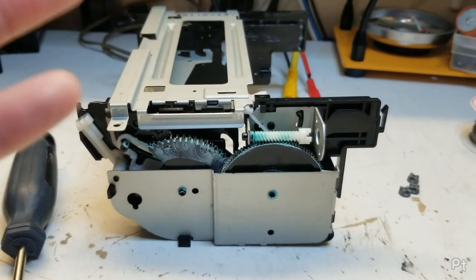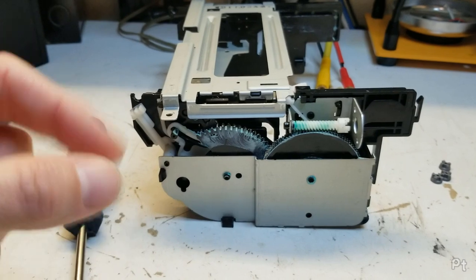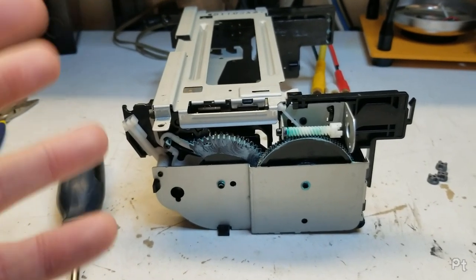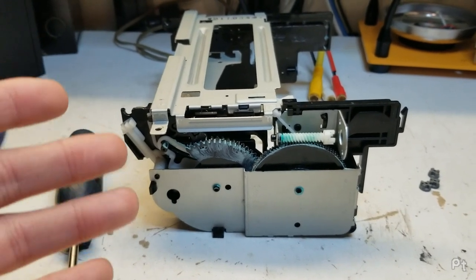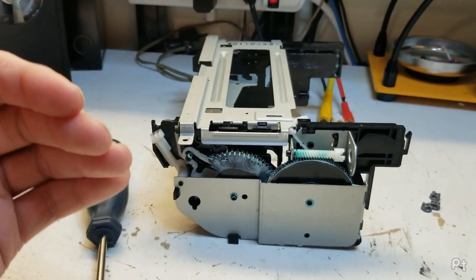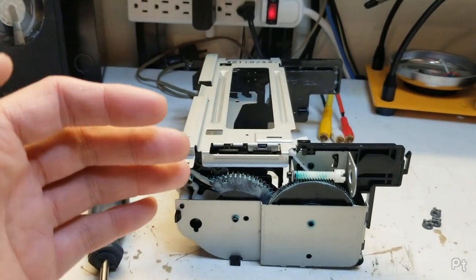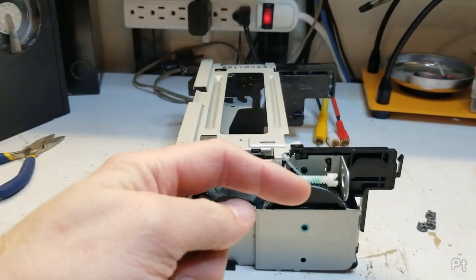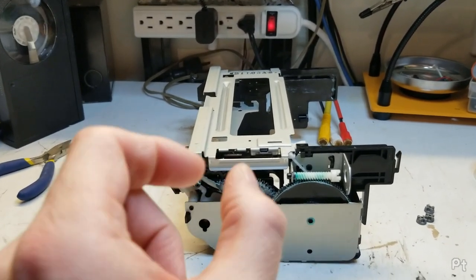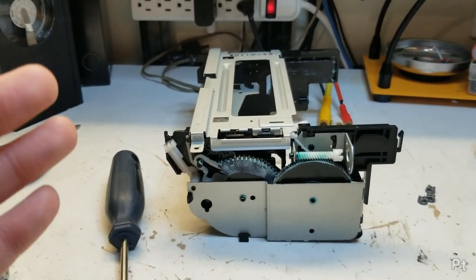Unfortunately, those video heads kind of condemned the machine. I spot checked some caps in the little video head amp circuit — they all looked fine, I compared them to new ones, they looked fine. The guides — the tape guides that go around the head — are pretty gummy. It's very stiff, feels like metal on metal, and sometimes it causes the gearbox to bind because it doesn't spin anymore. My dang epoxy is so good that it's a tight fit on that shaft. So yeah, the epoxy way is not great.